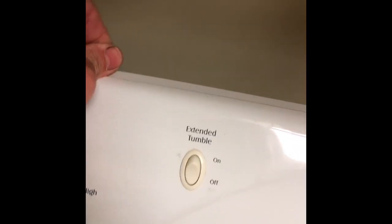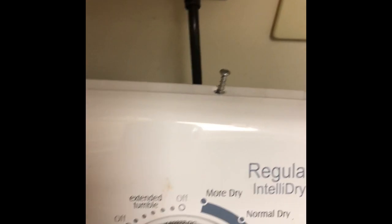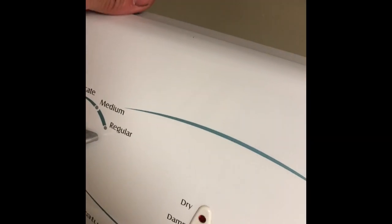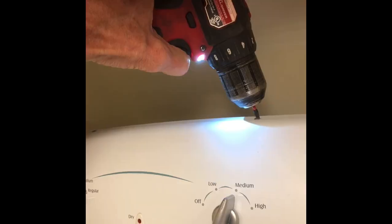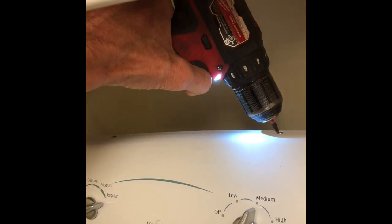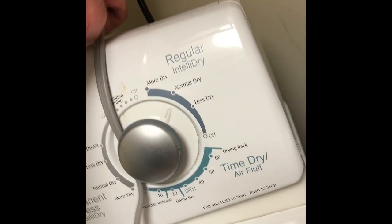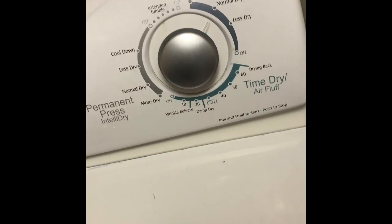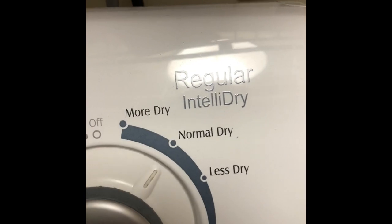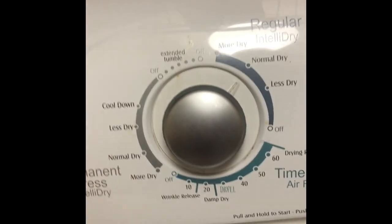There is a moisture sensor inside the dryer that's also really good to clean. Sometimes you get like a waxy coating due to the anti-static sheets, and it's good just to clean that off with a little water and a towel or some alcohol or abrasion to get off any waxy residue that might be blocking the moisture sensing. In this case, though, the timer not advancing was due to a faulty board.